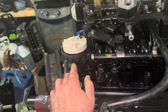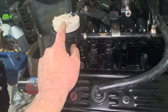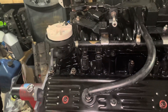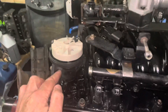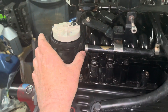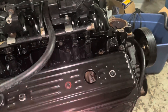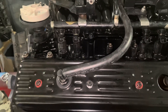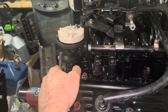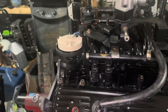To get the other 360 degrees you need a cam sensor, because the cam rotates at half the speed of the engine. The cam sensor tells the computer which 360-degree half it's in — either the first 360 or the second 360 — on cylinder number one, for example. So all you're doing when you rotate the distributor is adjusting the cam sensor to synchronize with the crank sensor. If you get outside a certain range, the engineers have programmed the computer to look for that cam sensor signal during a certain portion of the crank sensor degrees. If it's outside that range it'll set a code, and I think it'll still run but not in full sequential mode.